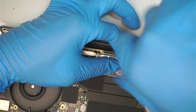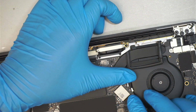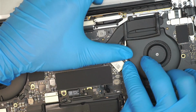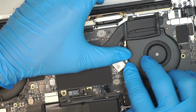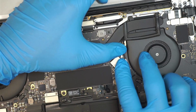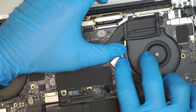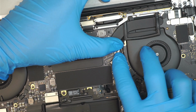Okay. Once you're done with that process, we're going to work on the Wi-Fi antenna. The longest Wi-Fi cable would go at the very bottom. And again, do not force it in. All you have to do is just align them in a very nice position on top of each other. When you press the connector down, it should just be very easy to push it in. It's almost no force to get the connector back together.